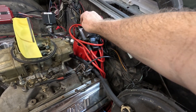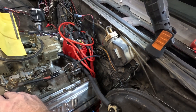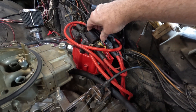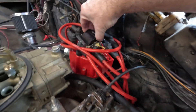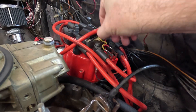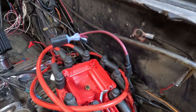Hey, it's Goodbyte here. In this video I'll show you how to test the coil on your HEI distributor. First thing you got to do — three screws right there, Phillips screwdriver, pull them out, try not to drop them. There are four screws holding the coil in, and you will need to remove the wires connecting here in order to get it out.